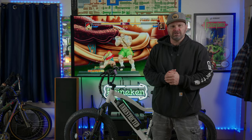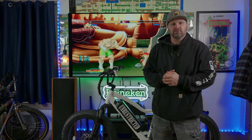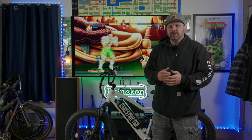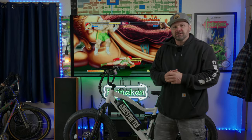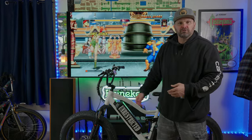Hey, what's up! We're going to be doing some hill testing on the Wired Freedom. If you watch my review, I mentioned a few times that I think this bike is geared too steep. To combat that, I've already changed out the rear cassette from the stock 11x28 to 11x34, and that made quite a big difference. But today I'm going to be doing a test on the same hill between the 56-tooth front sprocket, a 52, and a 46, which I've got here — trying to do some high-speed runs with each to see if ghost pedaling becomes an issue.